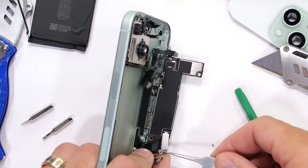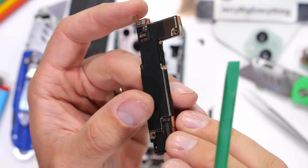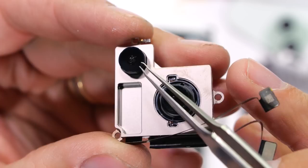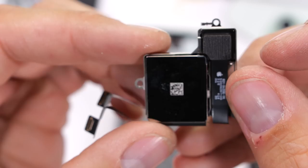The front screen gets removed the same way the back screen gets removed and costs $279 from Apple to fix. It's also a good time to note that this double stacked motherboard uses 100% recycled copper, gold, and tin. The dual camera setup on the back has three more screws. And while at first glance it does not look to have any optical image stabilization, the larger 48 megapixel camera in fact does — just internally with a sensor shifting mechanism instead of a lens shifting mechanism. It's actually pretty cool and Apple has been doing it since the iPhone 12.